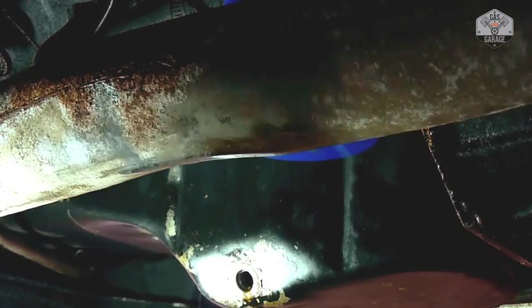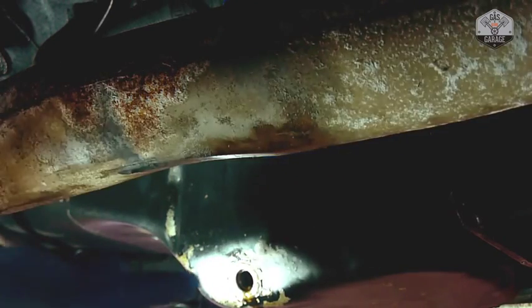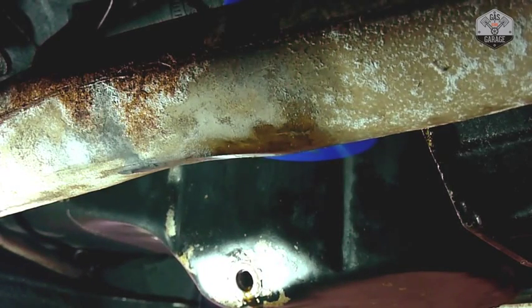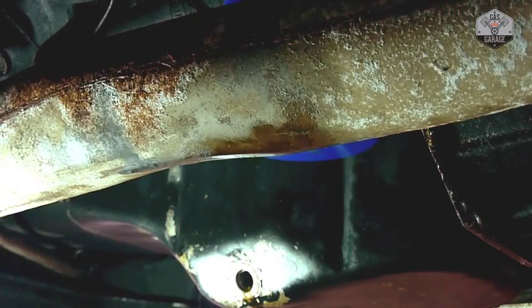One of the things you also want to do is after you uncap this and you start letting the oil drain out, you want to go up to the top and make sure that you have your oil cap uncovered from your valve cover, and that's going to help basically push the extra oil out, and just make sure that all that gets out there when you're doing this change.